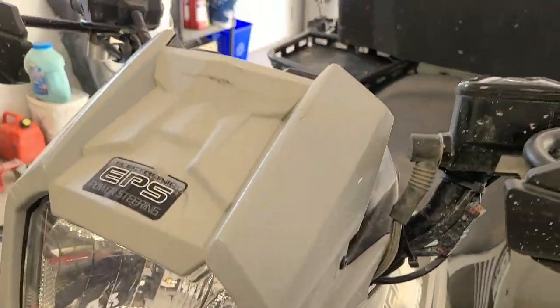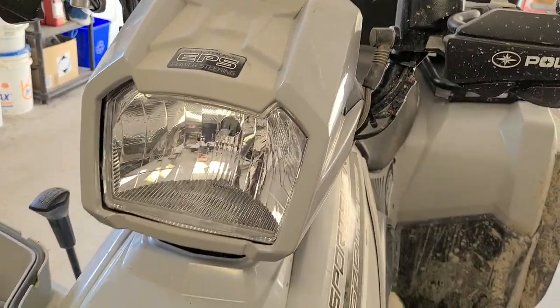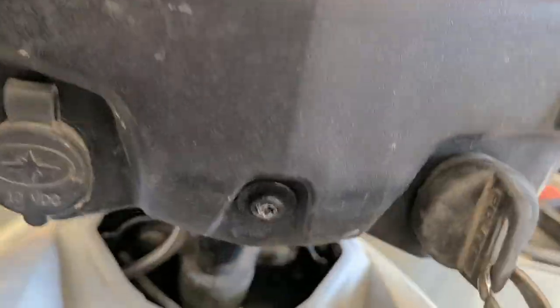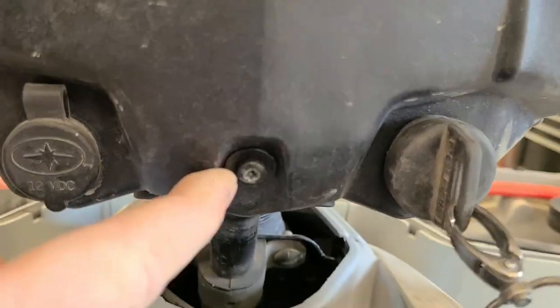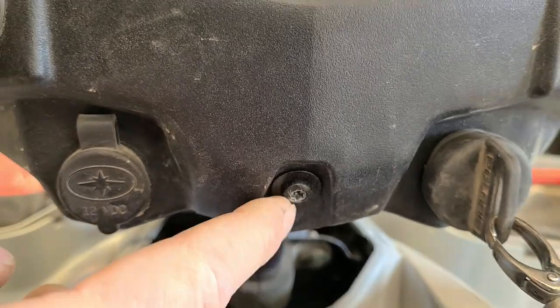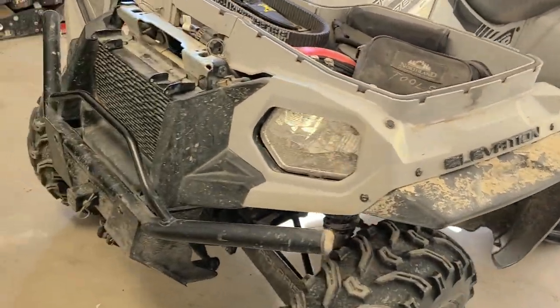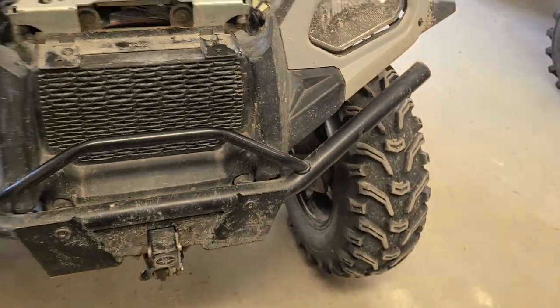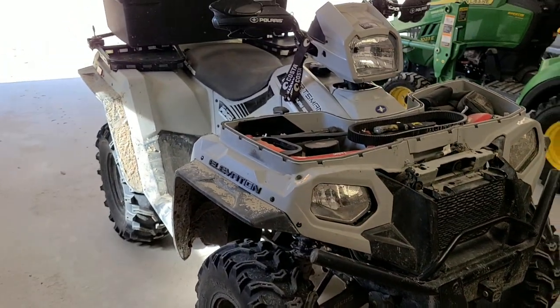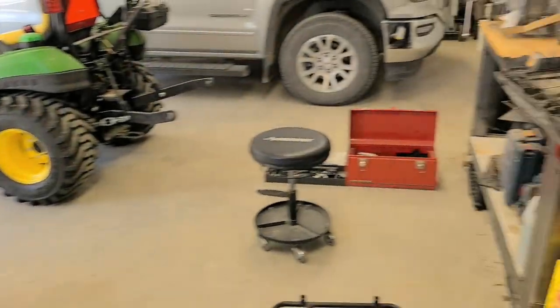The only other issue I had was this bent up a little bit, and I had to put my pod back together because I went over the handlebars. It pushed this pod off a bit and this screw here got pulled right through, so I had to pull off the assembly, pull the screw out, and just put a washer behind it so it holds. The rest of the machine is fine, there's no other broken plastic, bumper's still straight. But yeah, she's looking a little naked right now.